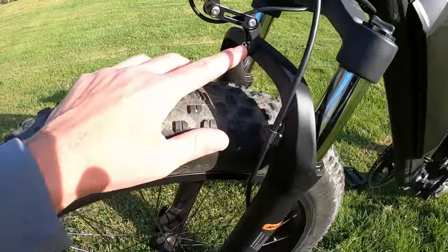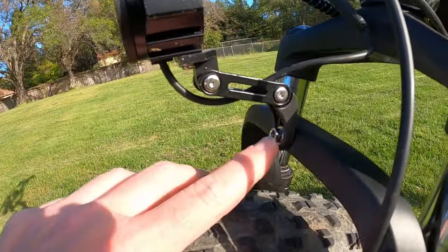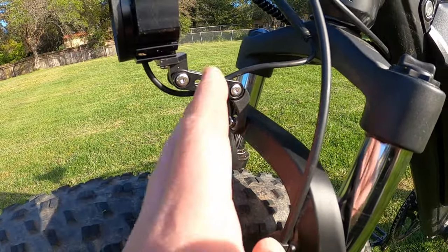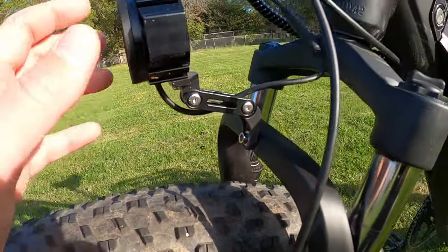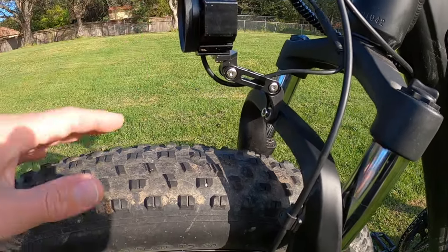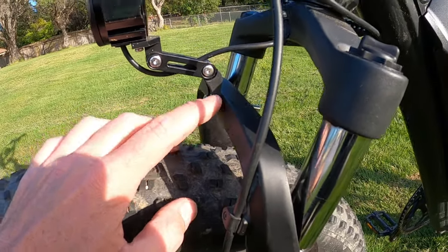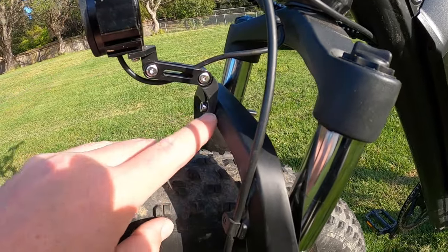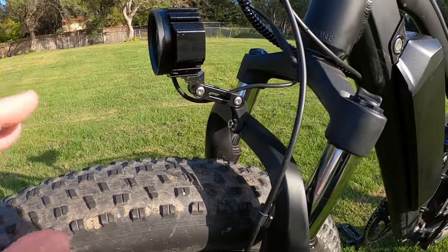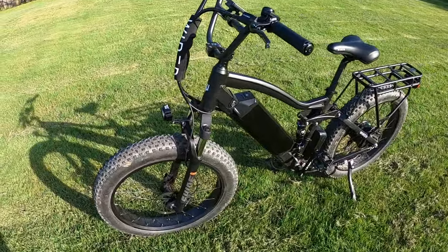The mount for the front light — I'm not really a huge fan of it. There's a nut on the back side and an allen bolt on the front, and the way they have you install it is with the fender sandwiched between the light and the front fork mount. If the light moves, it moves the fender too, causing the fender to rub on the tire. Once I removed that fender, I put a locking nylon nut on the back side and the light stays fairly tight — a lot more rigid without that extra metal tab.